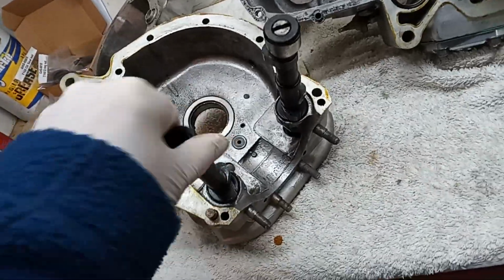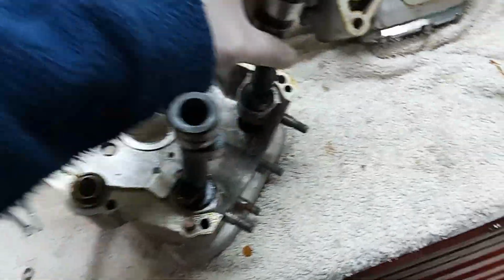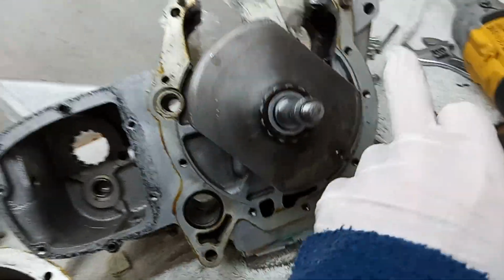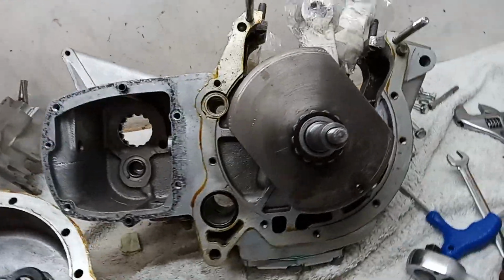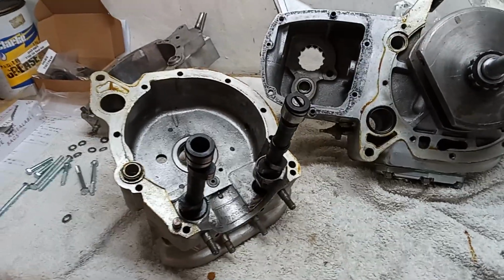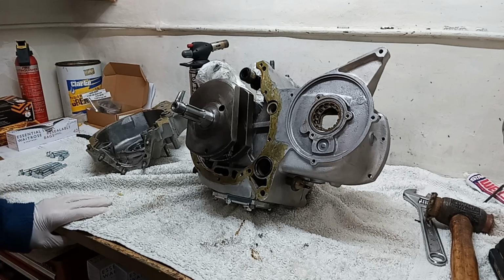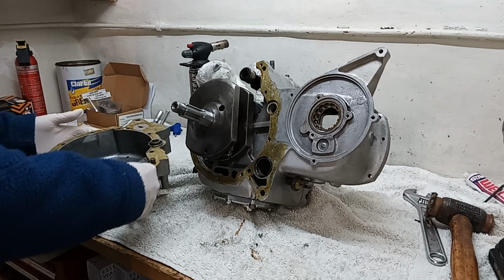I'll do this one-handed. So now I've got the camshafts in position roughly. I'll make sure they're fully lubed up. Then I'm going to redo a bit of Wellseal just to be on the safe side, and then put the cases back on again, exactly the same as before, but this time with the camshafts fitted. Okay, so now we're ready to put the drive side casing on.